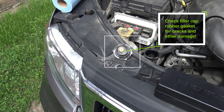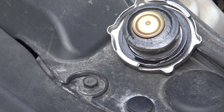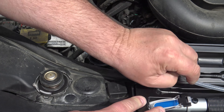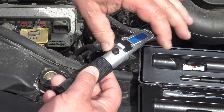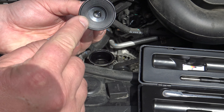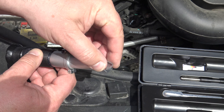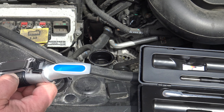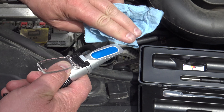We check the filler cap for the rubber seal — that there are no cracks and damage to it. Then we get the refractometer out. There is a little sucker on there, and this optical instrument is like a rifle scope. You look into one end; the light comes in on this prism end in the blue area. There is a little flap on there. We clean this thing from old fluid so it should be super clean, and then we put a sample on there.